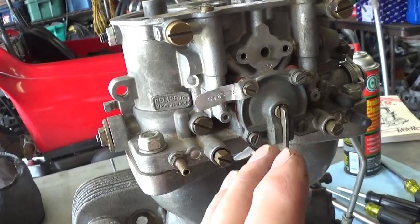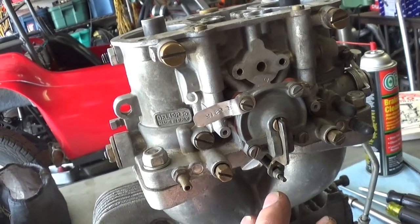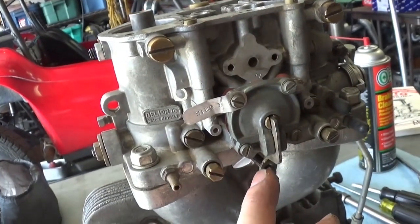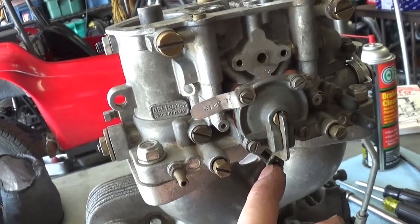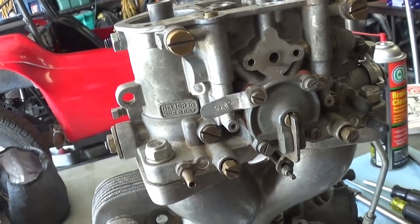When you just barely push down, you're coming to a little hill, or you want to keep the same distance with the car in front of you, fuel doesn't squirt out. It goes back into the float chamber there. And if you push on it quickly, that's when you need the extra fuel and you get the squirt. I hope that makes sense to somebody.